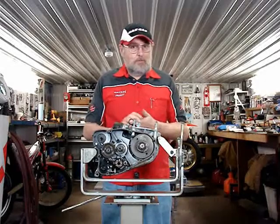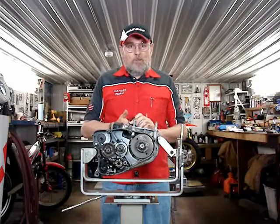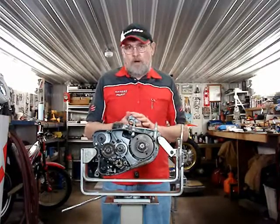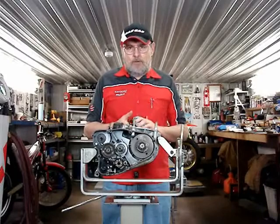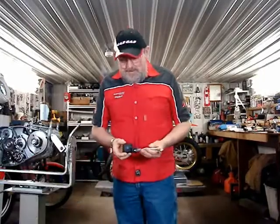I want to remind you as well, if you've got this apart, work on that water pump at the same time. Make that right. You've got these pieces off. Put some new parts in the water pump, a shaft and a seal. Get that up to 100%, and then you won't have any problems.